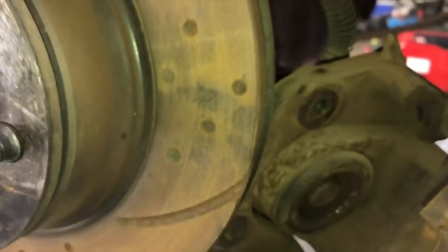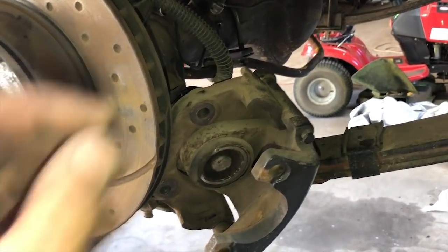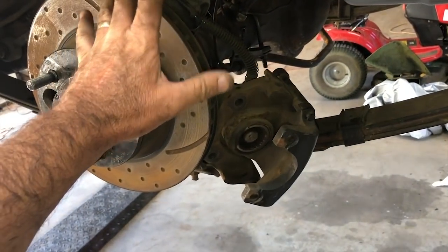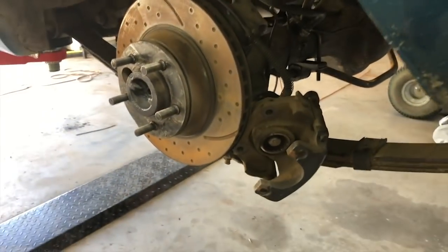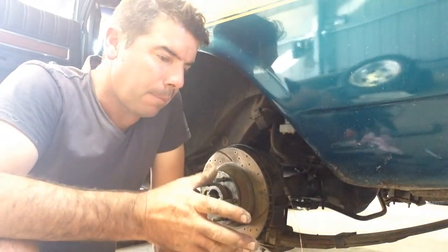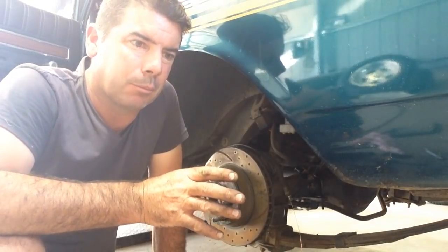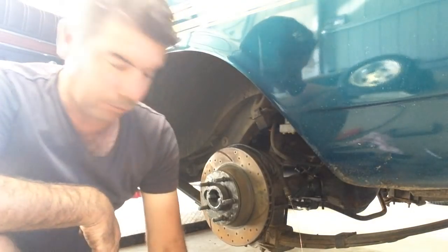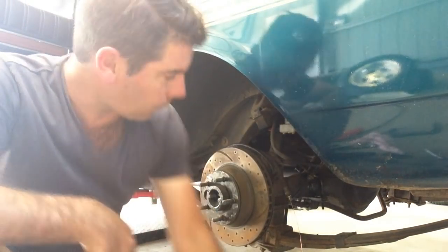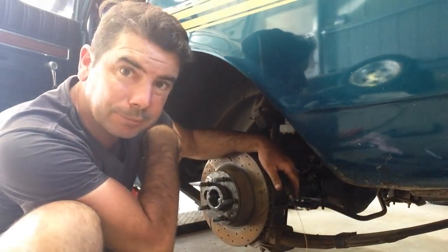So we'll put the G clamp here, try and force that piston in and force fluid back, and hopefully it'll be like unblocking a drain. It'll just dislodge it enough so that when we bleed pressure back down, it sits differently, maybe even flushes it. So G-clamp on, compress the piston in, but the air in the line is allowing it to compress without anything really beneficial happening. So caliper's off, we're going to try and thread the MIG wire back the other way and see if I can dislodge it.